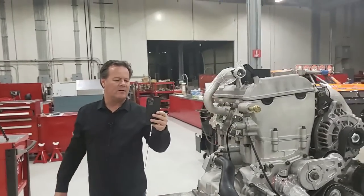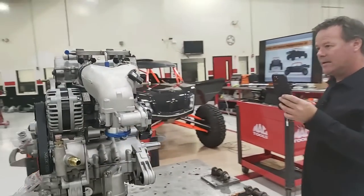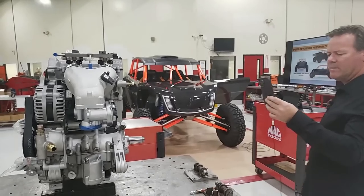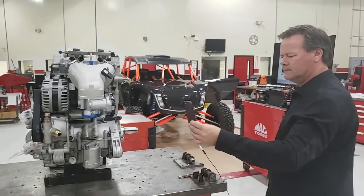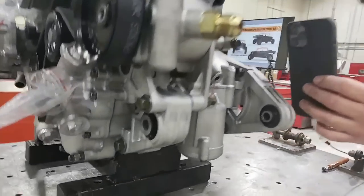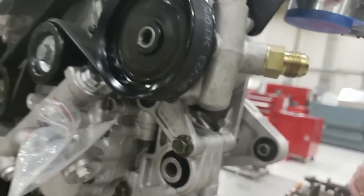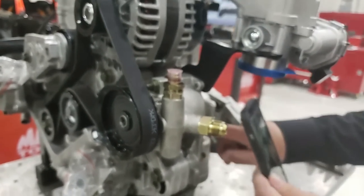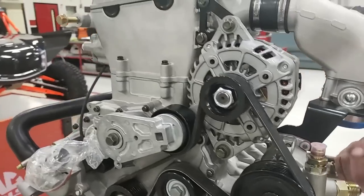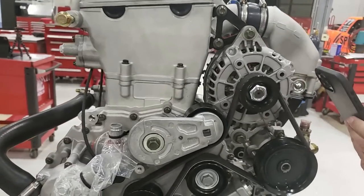And we put it on the scales. It weighed, with alternator and hydraulic power steering and throttle body and some plumbing, right at 151 pounds. We've tried to address every potential issue. And one thing I saw that obviously we've already noted is there's too many threads on here. You know, this is ideal. I want to see two threads at the end of every one. We'll address this one. We'll address this one. There's no reason for an extra four threads anywhere. There's acceptable, non-acceptable.